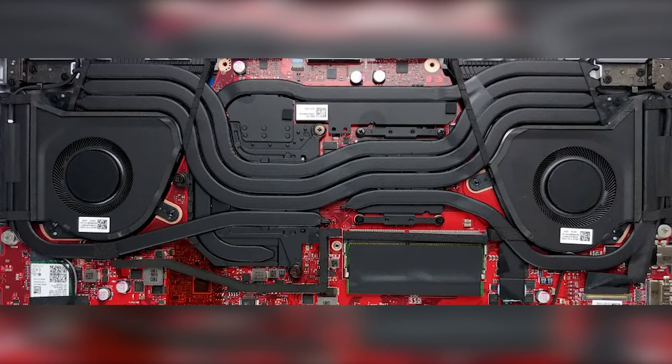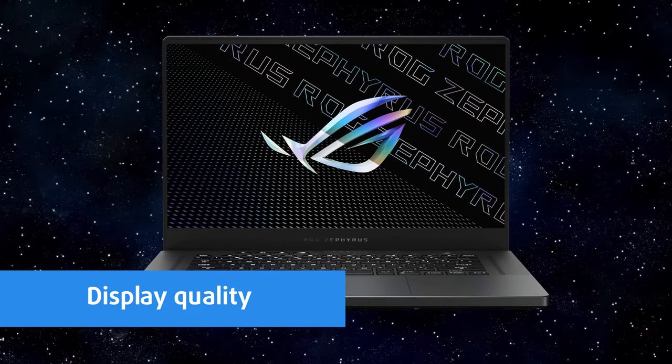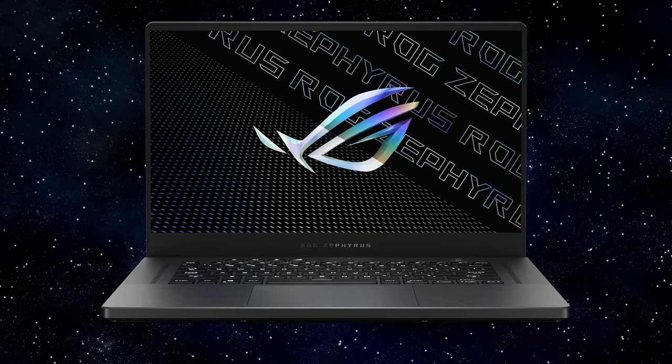The cooling solution comprises three heat pipes shared between the CPU and the GPU with one more dedicated to each of them. Also, there is one additional heat pipe that takes care of the graphics memory and the VRMs. Keep in mind that ASUS has supplied the notebook with a total of four heat spreaders, as well as two fans.